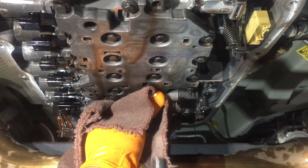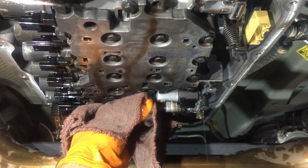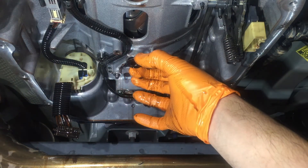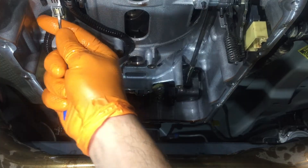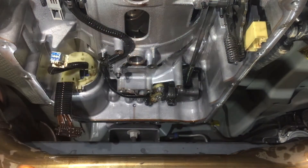This is going to be one of those 'do as I say and not as I do' moments — do not use a rag to touch anything on the inside of the transmission. This valve body was super hot as the customer had just driven it in; that's the only reason I'm using a rag. If you have to use a rag, use a lint-free one. Now that the valve body is out, pay special attention to this seal right here. Sometimes it falls out, or sometimes it hangs in there a little longer and then falls out, but it has to go back. Undo this last connector and then you're ready to move on to the outside.